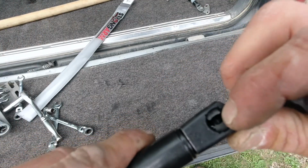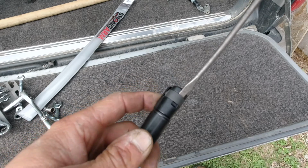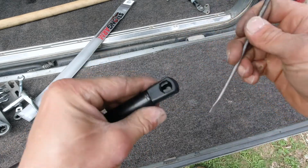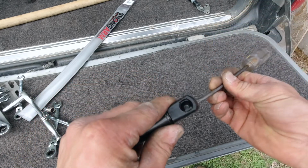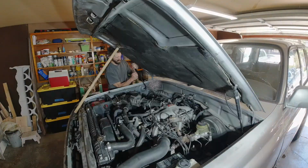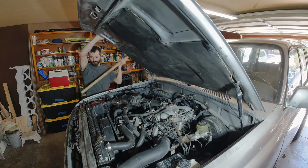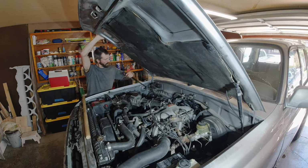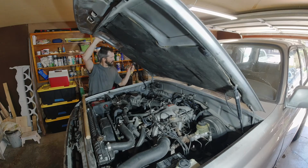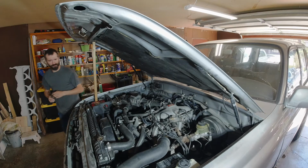Those are what hold the ball in. You gotta take this ring off. So we gotta use a screwdriver, a narrow screwdriver, to pry under there and pull that ring in order to get the, like, watch when I pry on it, see how the jaws open up? So I'm going to pry on it as I press it on the ball. One thing at a time. Pull the screwdriver out, and it's tight. Good. Now we can do the other side.